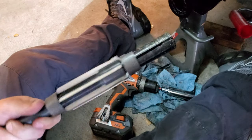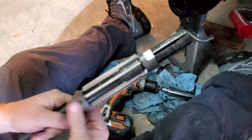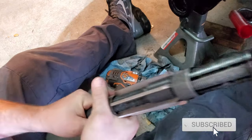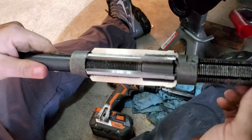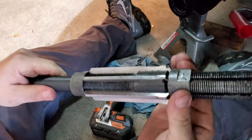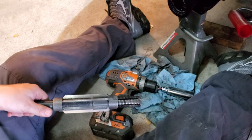Let's go ahead and start some reaming and I'll show you guys exactly what I'm talking about going through the process, okay? Let's lock this back down because it got a little loose. It's definitely something you want to check before you start reaming, that everything is locked in nice and tight, because if it's loose, you're going to have a jacked up ream. All right, guys, let's get you into position to see what's going on.